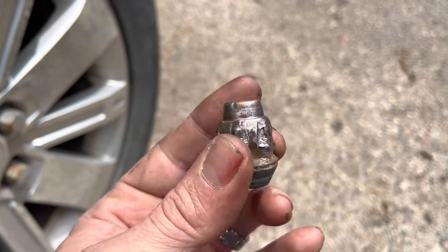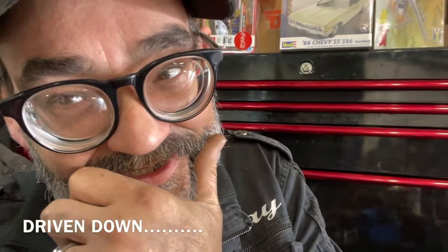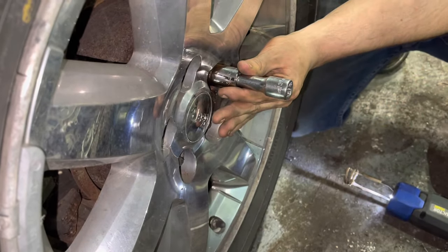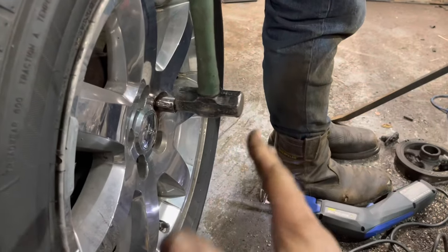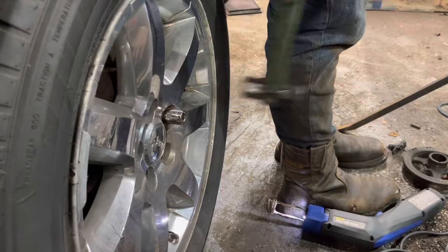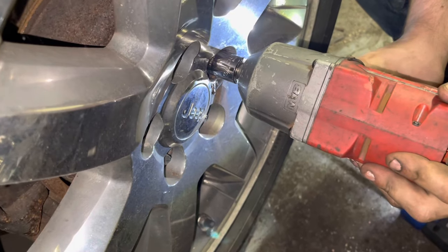You're gonna try to bang that socket on there straight — knock it in there as hard as you can. We want that thing driven all the way down. We'll grab a bigger sledgehammer so we can drive it on there as far as it'll go, to maximize how much socket we get on there. Hit that thing on there hard — that socket needs to be bottomed down onto that nut.